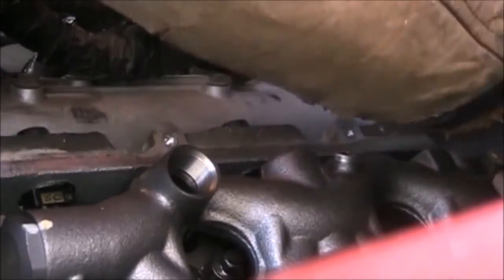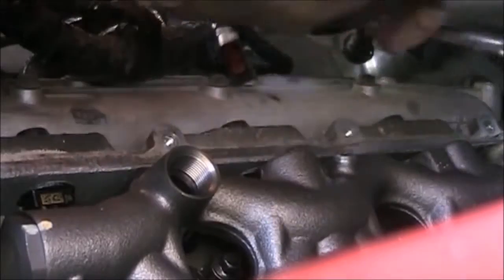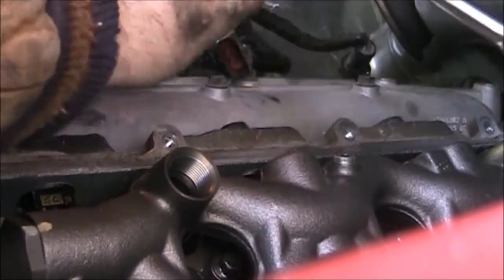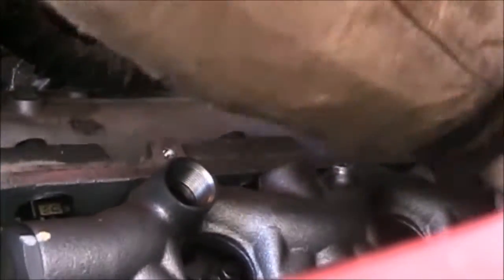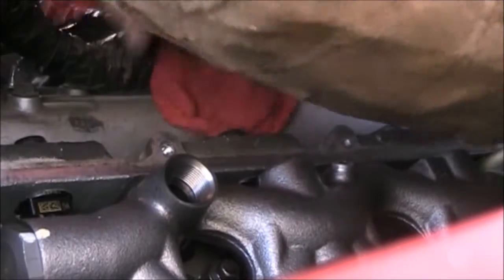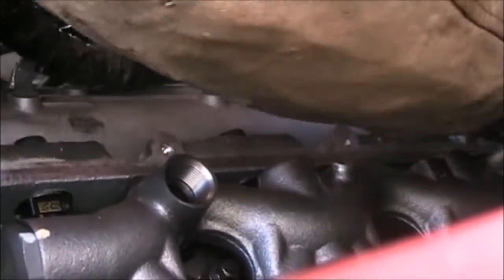While I was waiting for parts to come in I reinstalled the valve cover temporarily with just a few bolts, so I had to remove it again. The dummy plug was already out so I just had to remove the stand pipe. The lower half of the stand pipe didn't come out and there's nothing updated in the lower half. I decided it wasn't worth trying to dig it out — going by what people say that stand pipes almost never fail, and the updated part was in the upper half, I just left the lower half.